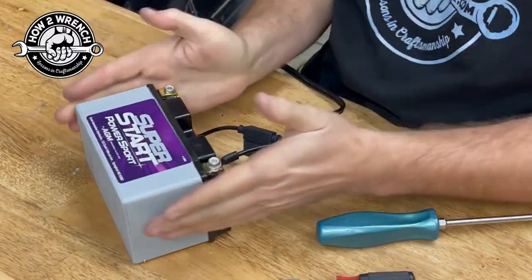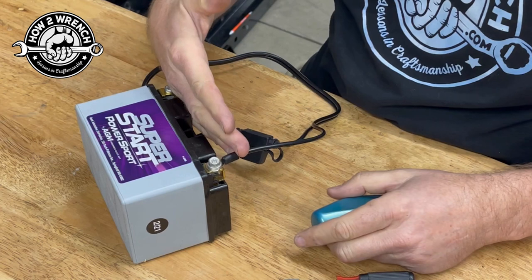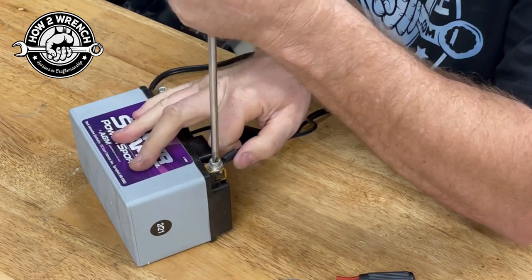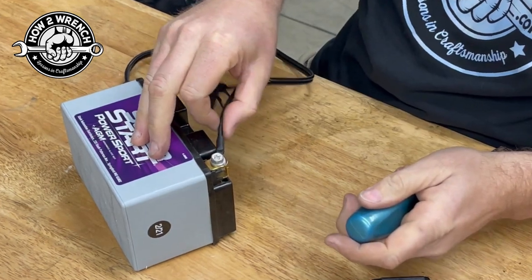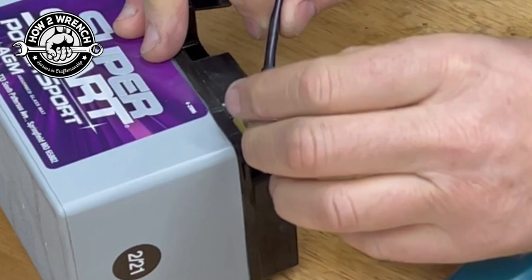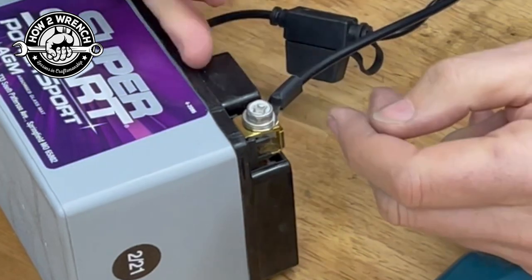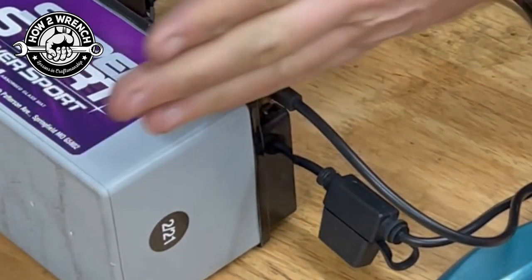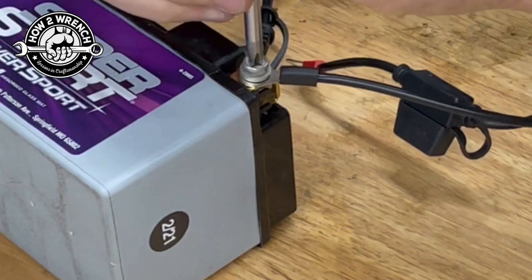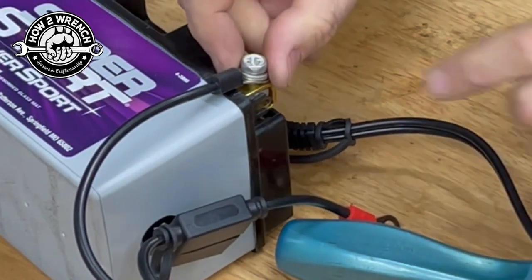The last thing to think about: when you put this in the motorcycle, think about the orientation of the eyelet. If the frame is right here and the battery box is right here, you've got to think about how it orients when you tighten it. If you go this way, this is taller — you're going to have to bend the cable to get it to clamp. You want the cable resting across properly. If you go the other way, are you going to hit the box? And the problem I see a lot is the eyelet flopped up over the side and just being a problem.